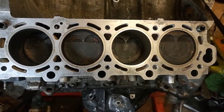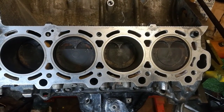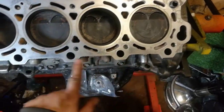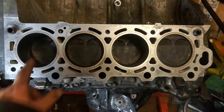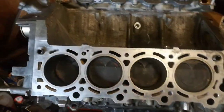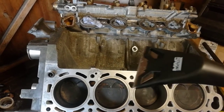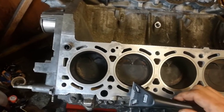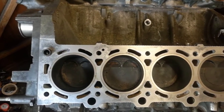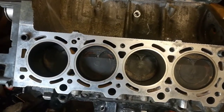The way I do it: I put shaving foam down in all the waterways and oilways — I got this tip from Hot Rod forum. Shaving foam goes down all the galleries and catches all the crud. Rags go down in the cylinders of course. Then I scrape it off with a blade — I know some people say you shouldn't because it can gouge the aluminium, but you can see it's wider than the width of most of it. Obviously I was careful and I got away without damaging any of it. So that's what I do to initially get the worst of it off.